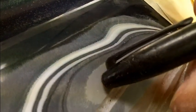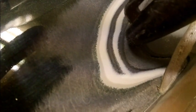Base fiberglass, gel coat, sealer. Okay? Then there's two more layers. That looks like base coat, clear coat, primer, base coat, clear coat, filler, base coat, clear coat, filler again, and then it looks like I made it back to primer here. This has been repaired several times.